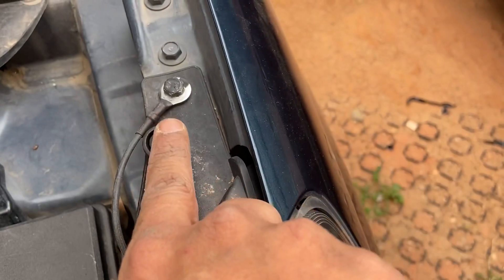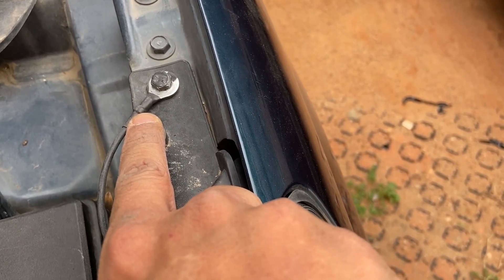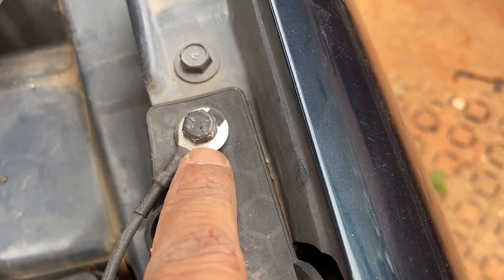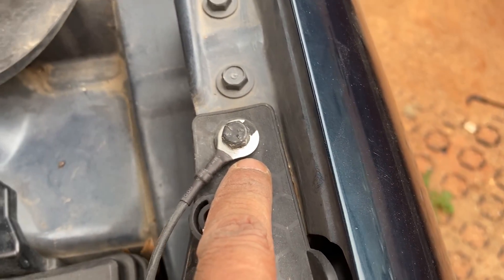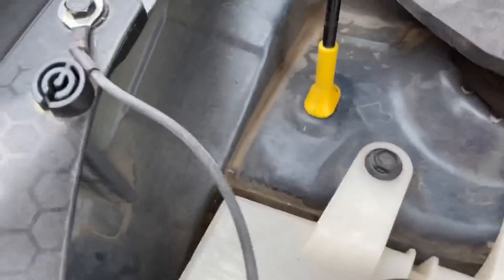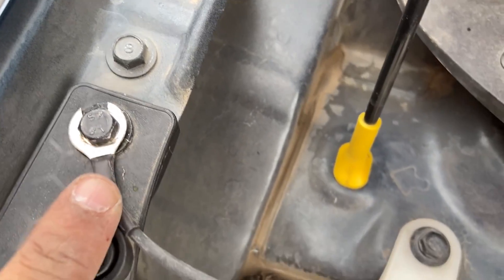You will have one ground wire from every headlight connector. We have connected one here — you can see it is sandwiched between the head and the washer. Hopefully we should get proper connectivity there, because sometimes paint can block it. On the driver side we have done the same thing.